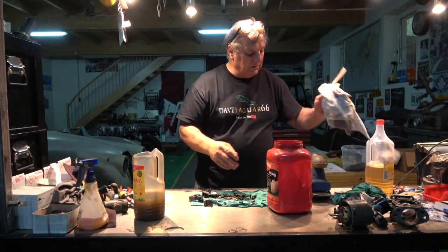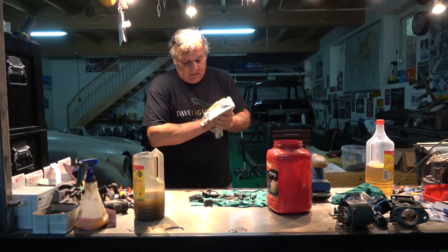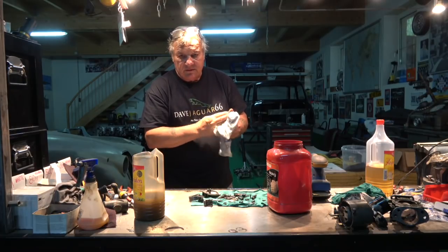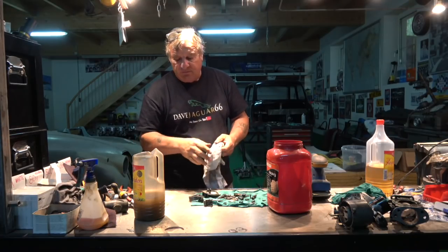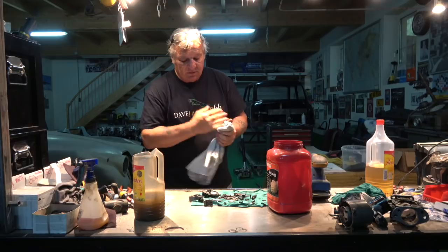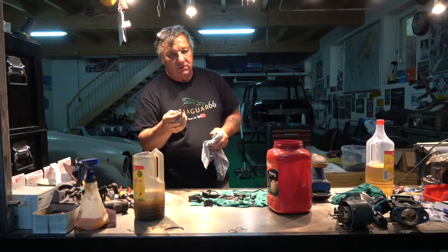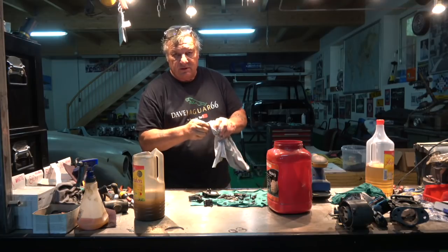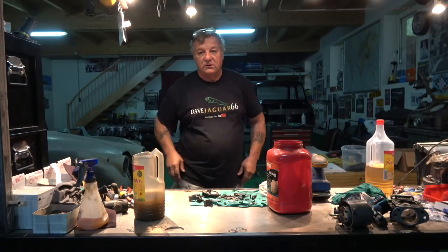So what I'm going to do now is pop this video up and show it to you. I'll clean this out, put some hot water in it, put some baking soda in it to neutralise this, give them a good shake and then dry them off. If they're very small parts, you could even use a heat gun. I've got a heat gun here, I can use it to dry them. If you leave them with the vinegar on them, they will rust within 20 minutes, half an hour or an hour. You can see the rust forming, a very light layer, but you can see it straight away. So you do need to neutralise it straight away.